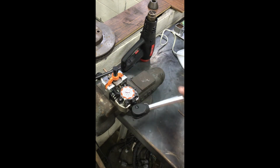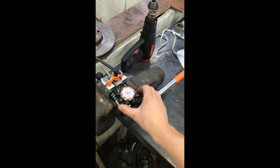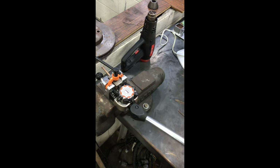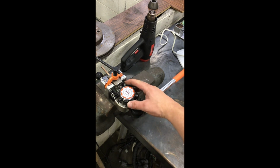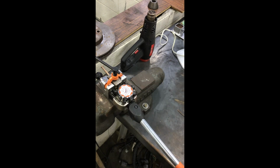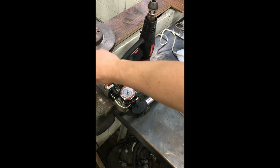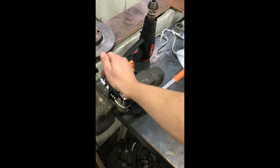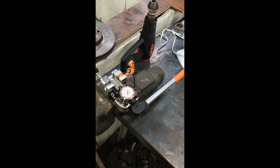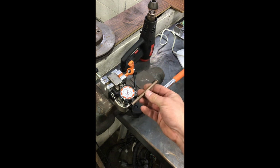Loose, set 1, tighten down. Operation 1, 1/4 inch in this case. Make sure you got the correct operations for the line you use. I know some of you will be using 3/16. I know some of you also might be using 3/8. Loosen this up. And then we have our flare on both sides.